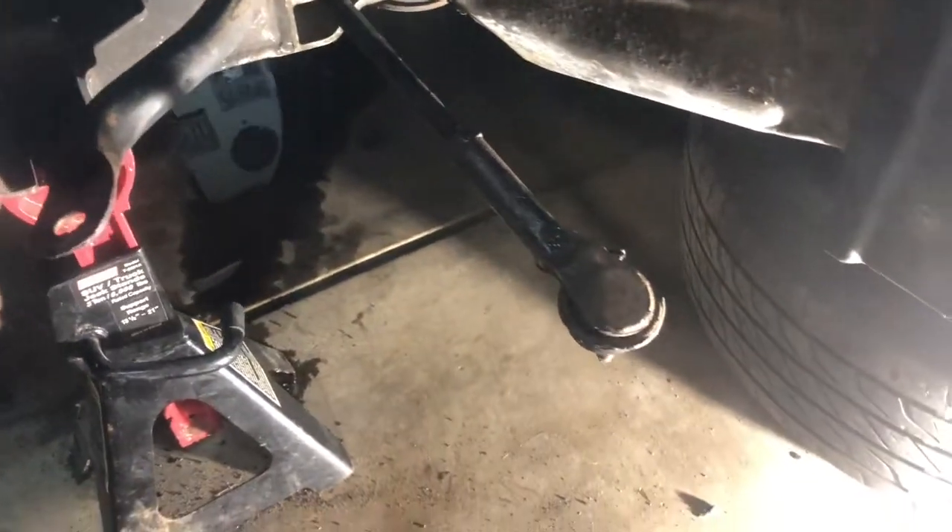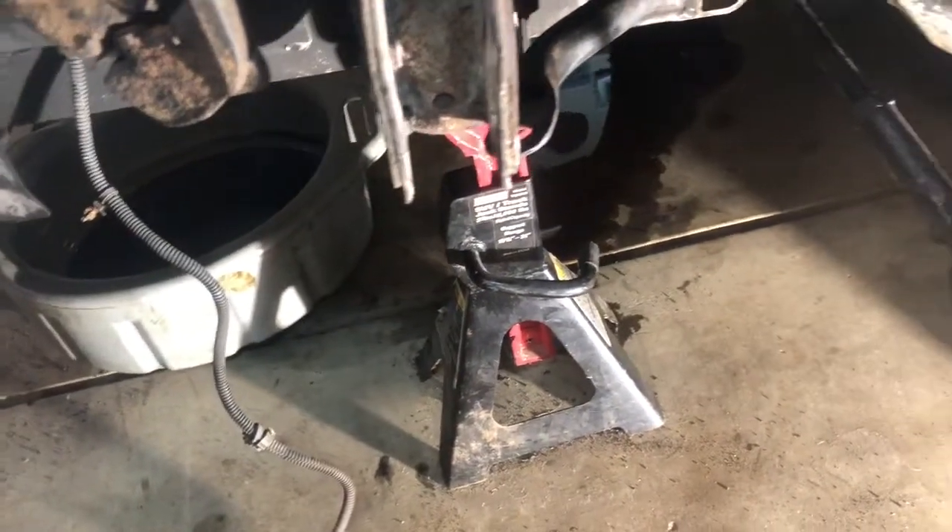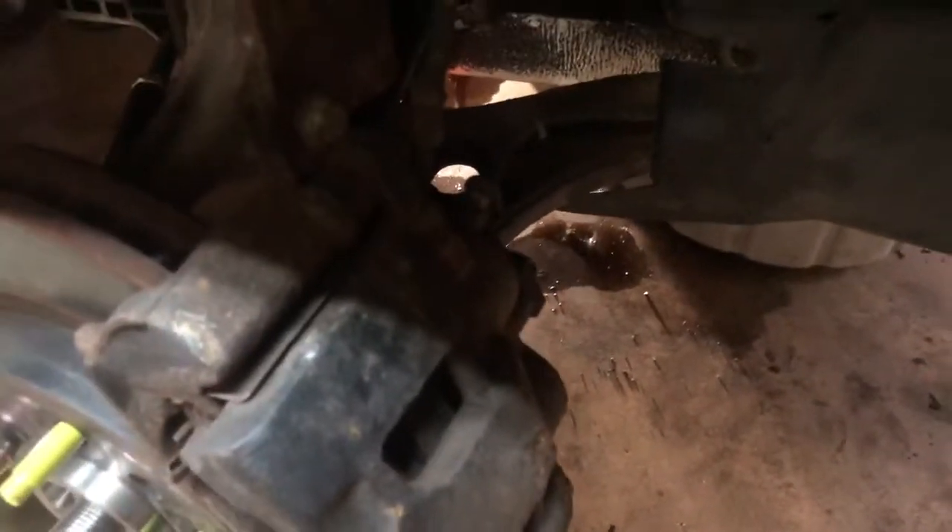We just got to clean up a little of the corrosion, and once we get that done we will start working on the tie rod — replacing the inner and outer tie rod here — and then we'll get the axle, the hub, and the rest of the assembly in here. Since I didn't replace the lower control arm on this side in part one, I'm going to go ahead and drop it out and replace it with the brand new one I have, so we'll have matching sides and everything will be even.